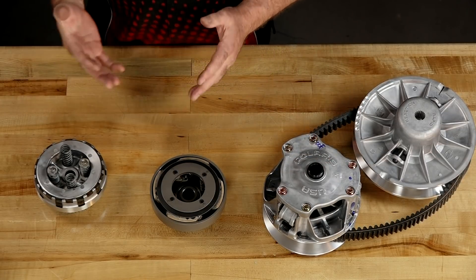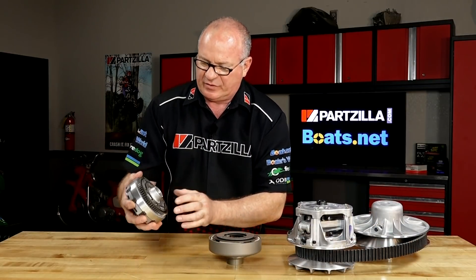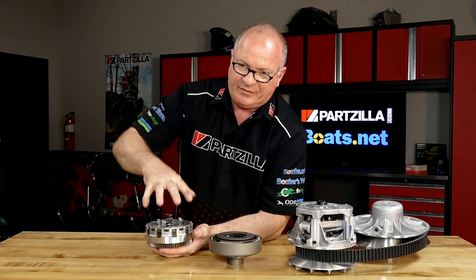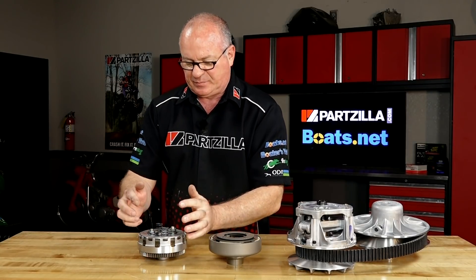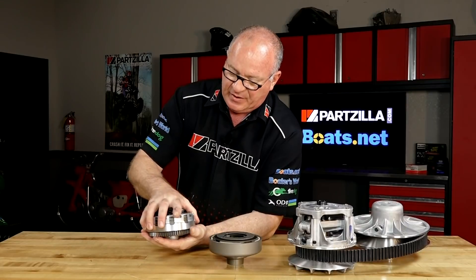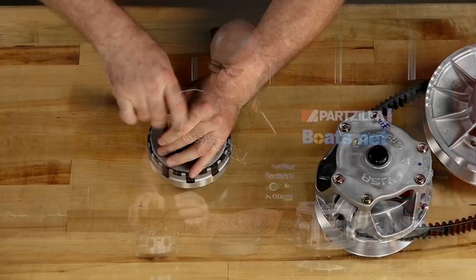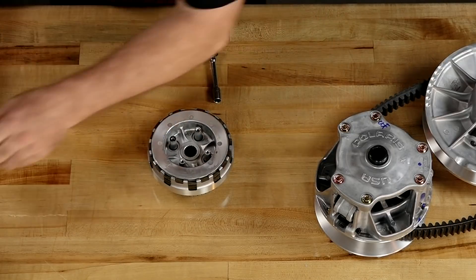First, let's look at what I call the pressure plate clutch disc type system. What you basically have is an outer gear being driven by the crankshaft, and it is transferring that energy or power to the center section through all these plates, which are compressed together by these springs. When you disengage the springs, it allows the basket to still be rotating on the crankshaft because you've got a direct connection there, and it essentially stops motion on the center part, which goes out to your transmission or output shaft. This one is somewhat put together and I'm going to pull it apart so you can see the inner workings of it.